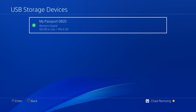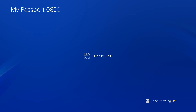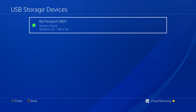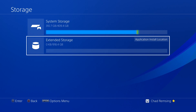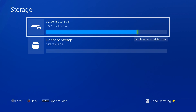Click OK and it'll give you a running list of all the devices plugged into your PS4. You can stop using them at any time, which will turn off the green light indicating it's an active storage device, and you can re-enable storage whenever you like. You can also manage the content stored on here — you can see the extended storage, everything installed on it, and how much space is being used versus your system storage.